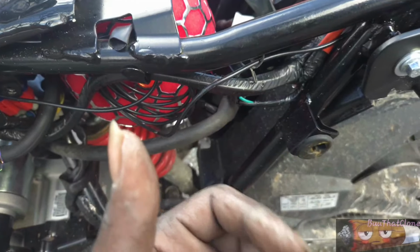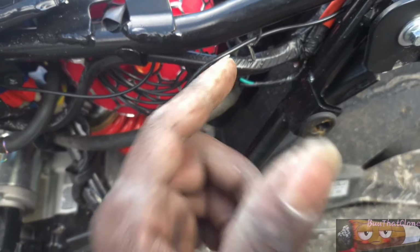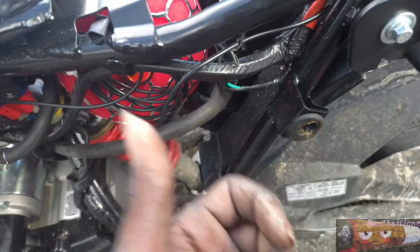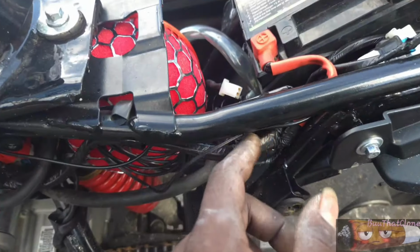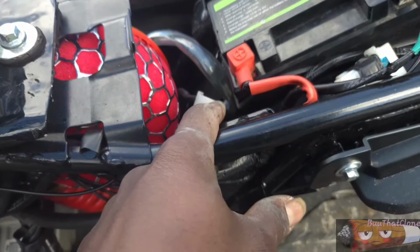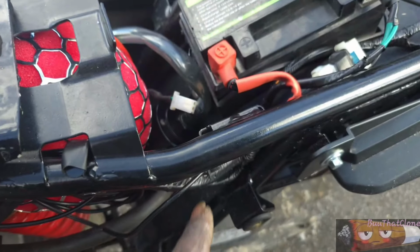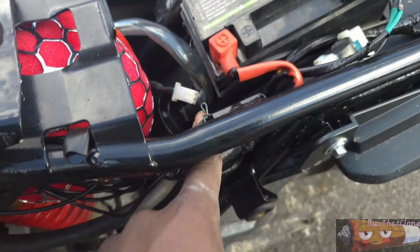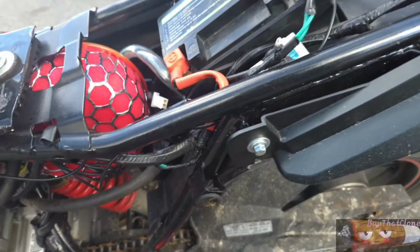Yeah, no, I have to take those out. I'm actually about to get ready to go get some plugs for this catch can. I'm going to take it off, go to Home Depot and get a couple of those. And as far as the actual vent filter, because of the height of it, it was hitting the battery. There wasn't enough room for me to actually leave it up top, so I had to swing it around somewhere. For now, I just got it over there.